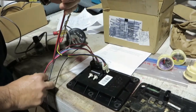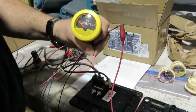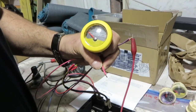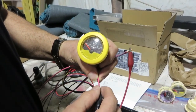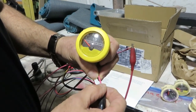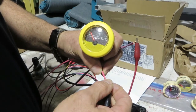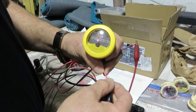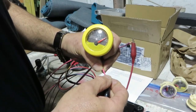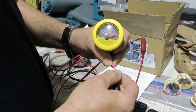The fuel gauge is going to be next, and that's going to be the pink wire. We're going to go ahead and power it up. It chatters and we have no fuel showing. Now we're going to ground the pink sender wire. The fuel gauge has a delay built into it, so don't expect the needle to jump right over to full — that's to prevent false readings if your fuel tank is sloshing around. A lot of mechanics expect an immediate needle swing; that's not going to happen with the Medallion system.